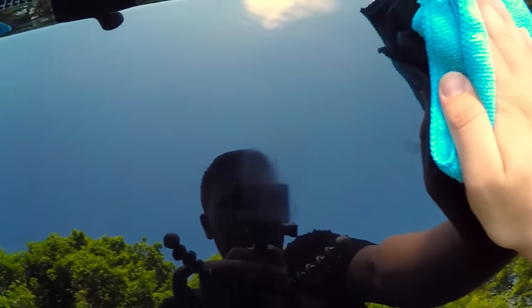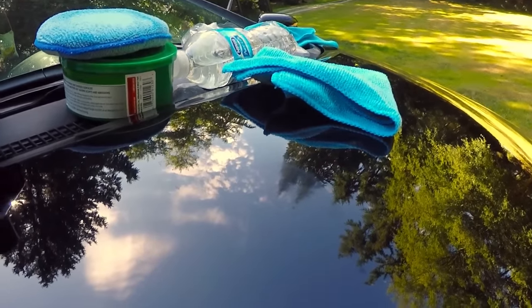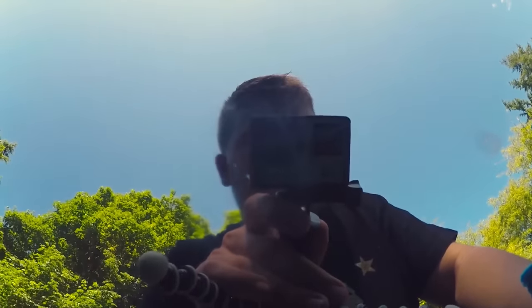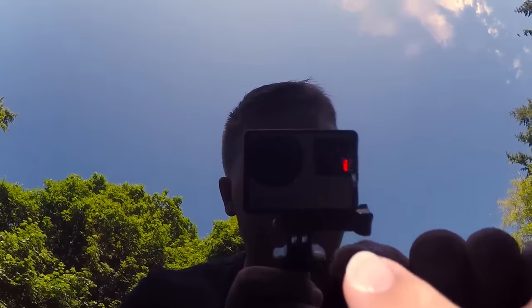You can see just from that one wipe it's started to buff out and shine. Going back for another pass — that scratch is almost gone. One last layer to get those remaining scratches out. Now it's pretty much gone. The only thing you can see is the little nick where the paint pen didn't fill in at all — that was my own mistake — but other than that it's shiny all the way around and looks great. I just have to work on the rest of the hood I messed up. Thanks for watching, hope this helps.